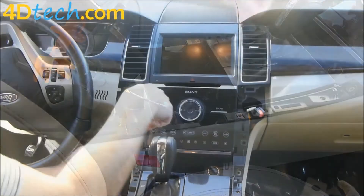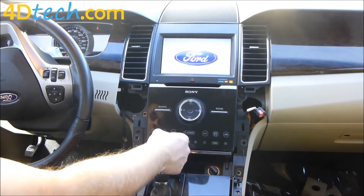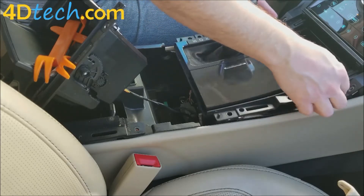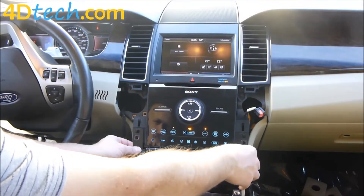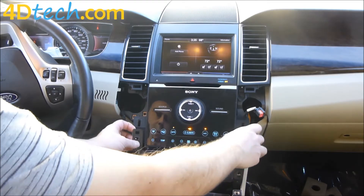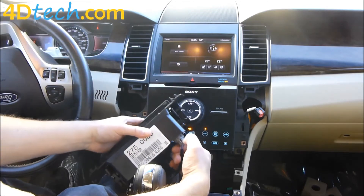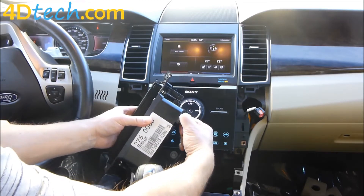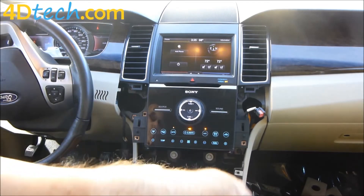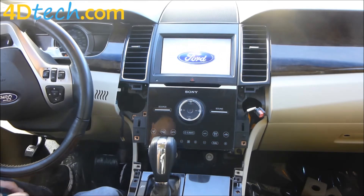In order to get this one back, we're going to have to turn on the ignition. We'll tap the button twice without holding the brake pedal in, then hold the brake pedal in and move the shifter backwards. Then we can move the shifter plate backwards — pull up and move it back. We'll get this coin tray and outlet out of the way. It has to pop off the upper tabs, then pull down and come out. Spin it around, push this tab in and unplug it. Then we'll move the shifter back into park and shut the vehicle back off.